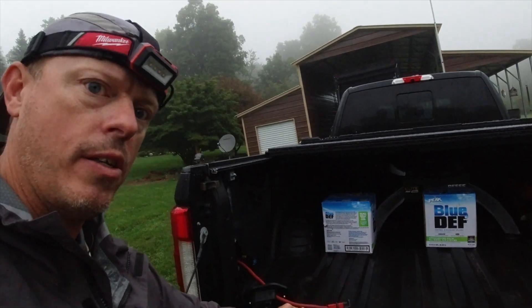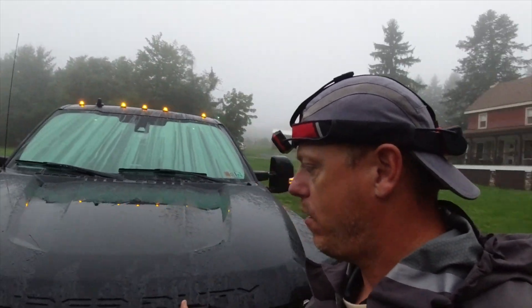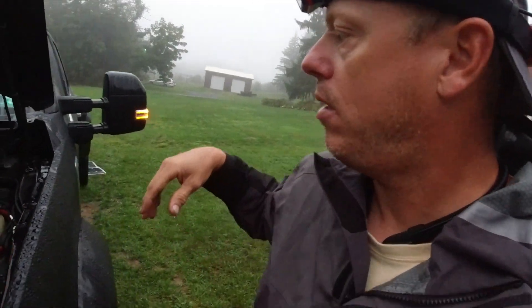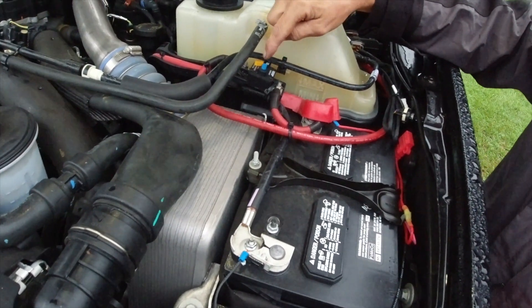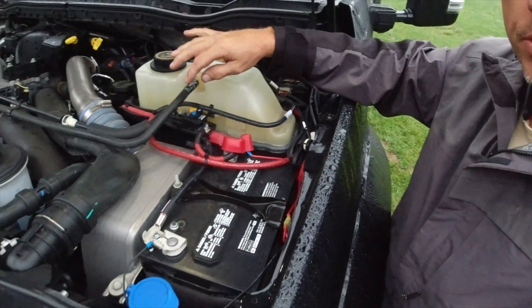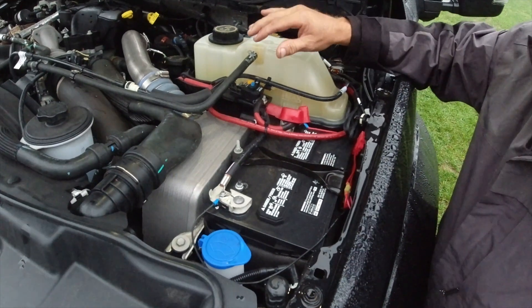The ground runs back here, all the way along the bottom, comes up into the engine compartment, straps off, and then up here we come in. Right here we have a 100 amp circuit breaker which we leave open unless he's going to do the truck charging. It comes over and connects to the battery, which in turn connects to the whole system — alternators and all that.